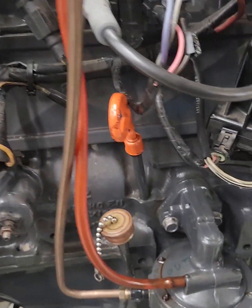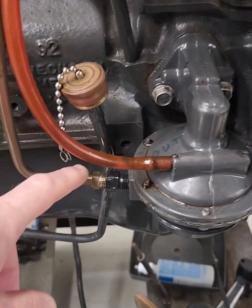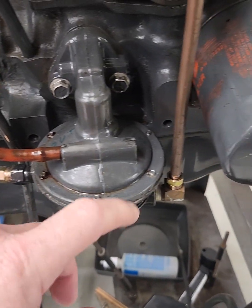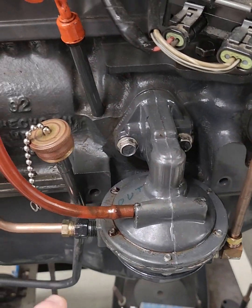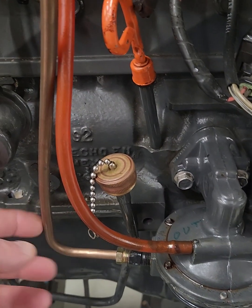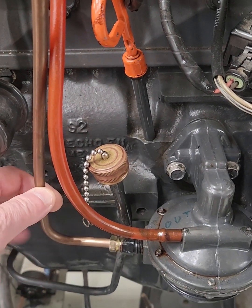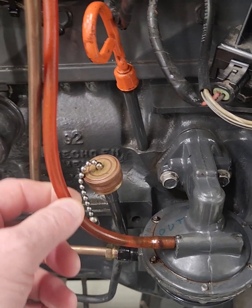The fuel pump in question is right down here. We have our fuel line out going up to the carburetor, and our fuel line coming in from the fuel water separator. Basically you have two steel lines — this is actually copper-nickel. We've changed this over to copper-nickel and have students learn how to bend and flare fuel lines.